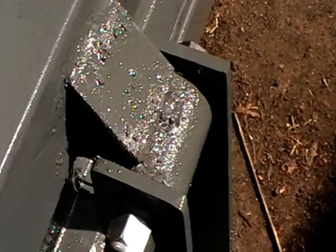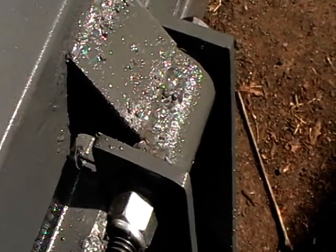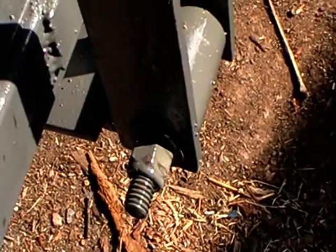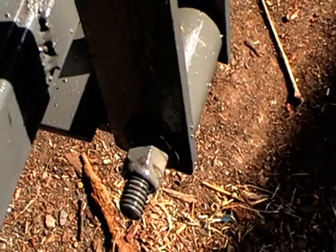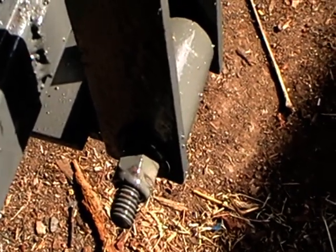The top mount is the part I cut off the end of the leaf spring — it's about an inch long — and then it has the pivot point with a bush through it. The bottom is the bottom part of the leaf spring, which now goes underneath the trailer, and they're both mounted into pivot bushes. They both can swing freely but they are quite tight.